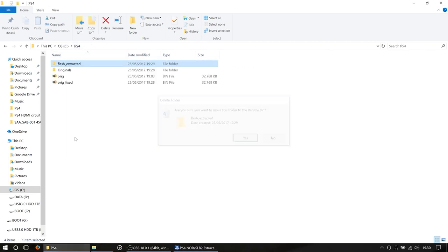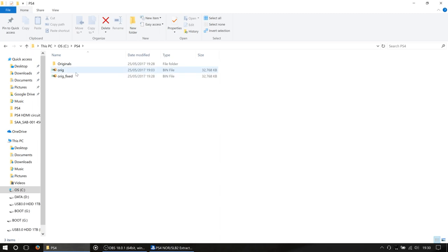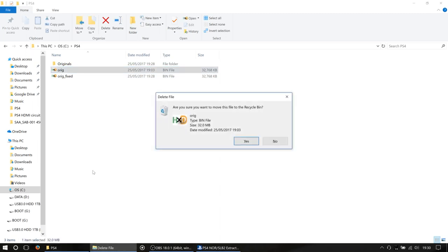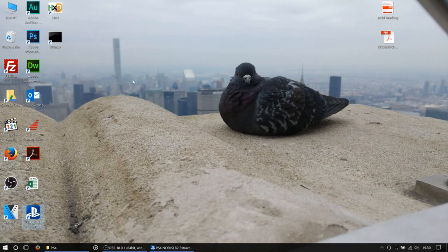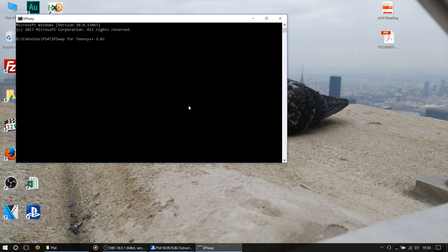So we're just going to delete that folder because we don't need it. We're going to delete orig because we no longer need it. And we are going to flash this orig_fixed back to our IC. And we do that by going back to SPIWay. This time we are going to call SPIWay.py, COM3, remember. This time we are going to go to VWrite and we are going to point it to C:\PS4/